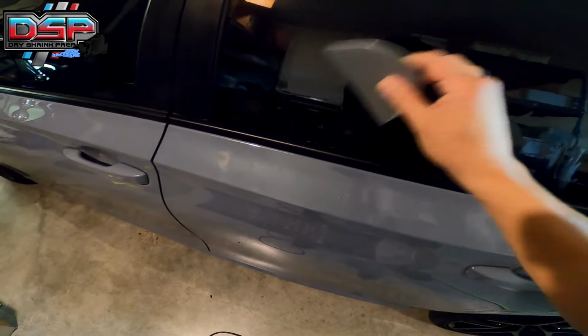Also, when you're having your heat gun here and you're carding, this is why you say heat gun straight up, right? Up like a gun. Because if you're carding and you turn the heat gun this way and point it in a different direction, look, I just smoked that film. If you're trying to card and the heat gun is pointing at the overlapping film, you're smoked, because you're going to destroy film, and now you have to start all over. So protect the overlaying film as much as you can. That way you don't have the heat gun pointing in a random direction; it's always straight up.